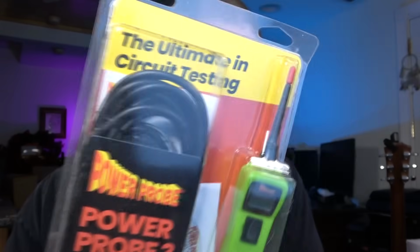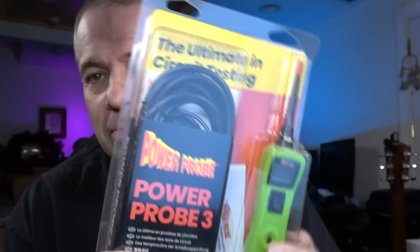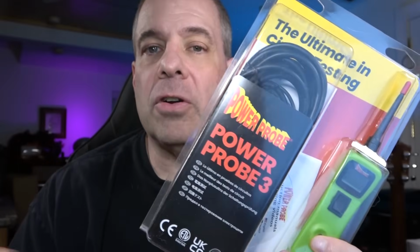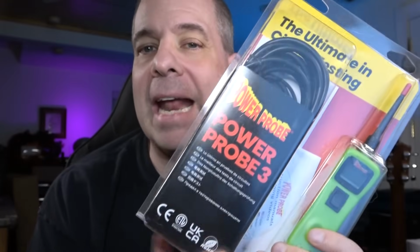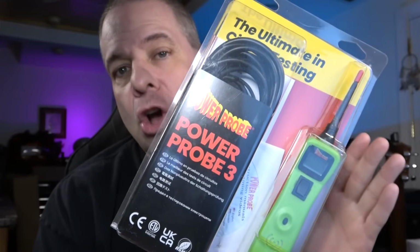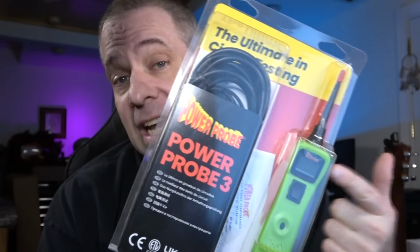Oh, I should have shown you this first, the Power Probe diagnostic tool. This is the Power Probe 3. This adapter goes in between this probe and the unit. Just pop that off, stick this in line, put your probe back on, you're set to go. This is the indispensable diagnostic tool. If you're not that good at electrical stuff, this is a great tool to get you better at it, because you can walk through an electrical system piece by piece, do your diagnostic to see where the failure points are by doing a number of things. You can check for voltage, check for continuity, it checks ground, and it injects power. So between those 4 functions, there's very little electrical stuff that you can't do a quick, basic troubleshooting on to at least isolate the problem and know where the failure point is. And then you can dig in more from there.